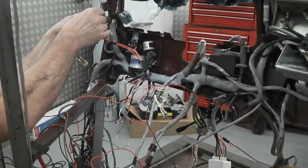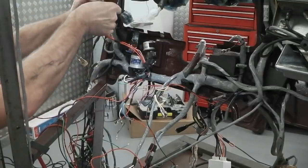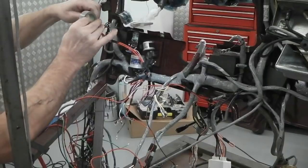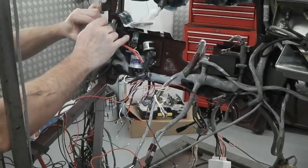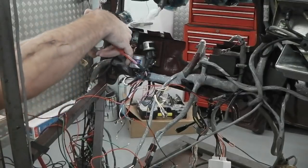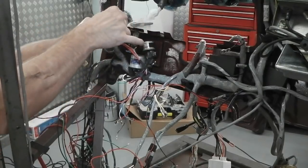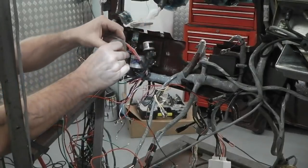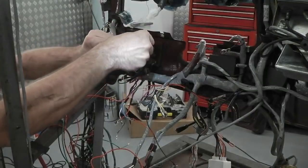So it looks like a lovely little factory loom. Around we go, nice and tight. And then a bit more of an acute angle, because there's not many cables, so you can get away with less tape by getting the full width down. Make a beautiful job. We'll even put a pass label on it. I'll show you one of them, courtesy of Mark III.